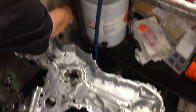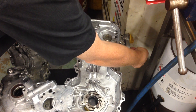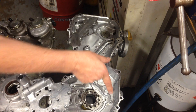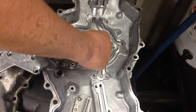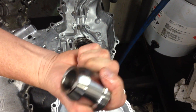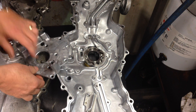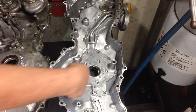Up the top here is where you put the oil in the engine, so it drains down into this hole here and eventually finds its way down into the sump. This part here is the oil filter. And as you can see closely, just down inside here is some of the valving to control the way the oil pressure relief valve works. But most importantly, what you can see here is the oil drive for the oil pump, which spins in a machined casting of the front of the engine cover. This actual part here bolts onto the front of the crankshaft, comes up from underneath, but eventually spins the oil pump, which creates the oil pressure in behind this casting, which normally sits on the front of the engine with the different ports.